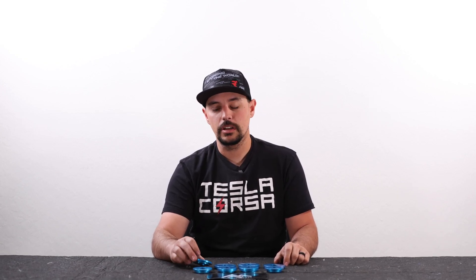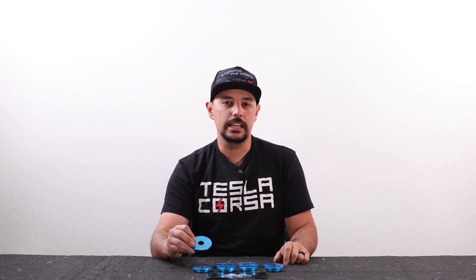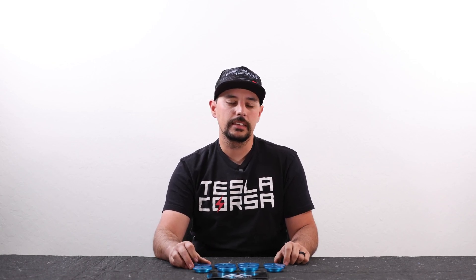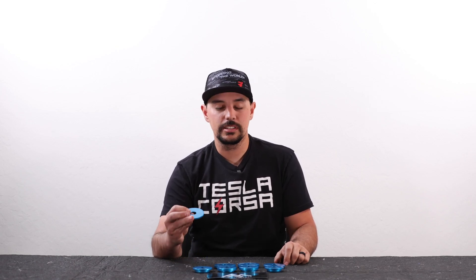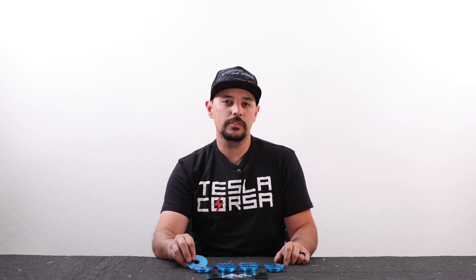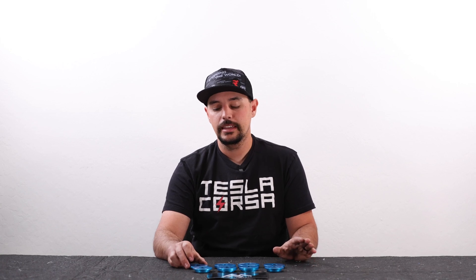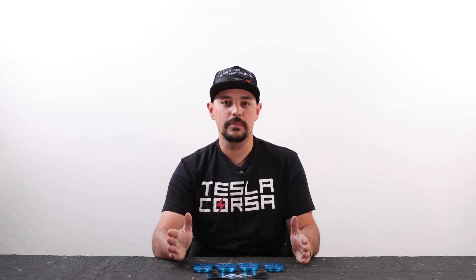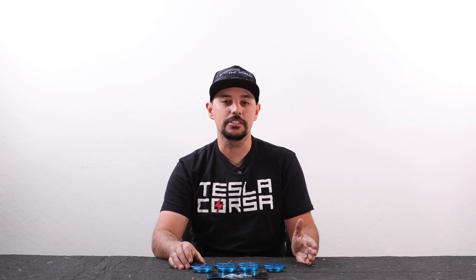For an example, the car we're putting it on today — Tim had his car track aligned, and pretty much every time we put it on the rack he would have different settings. So the aim was to install these and hopefully get consistent readings every time we put it on the rack. And you'll see in the video that as soon as we put these in, it shifted the subframe into a center location and actually fixed the alignment pretty spot on to where we had it initially.